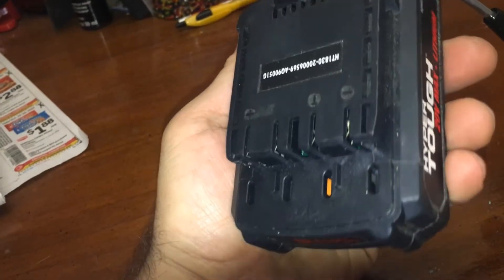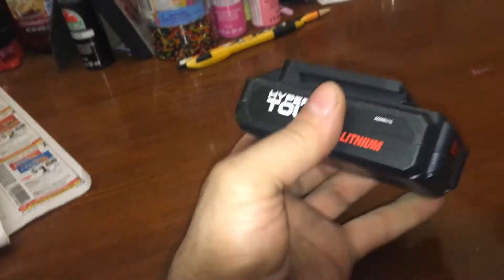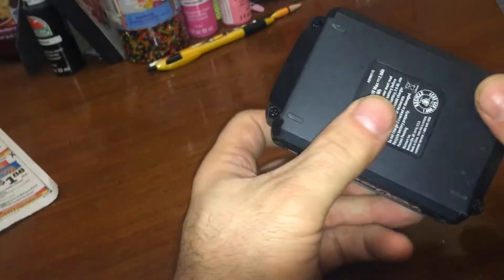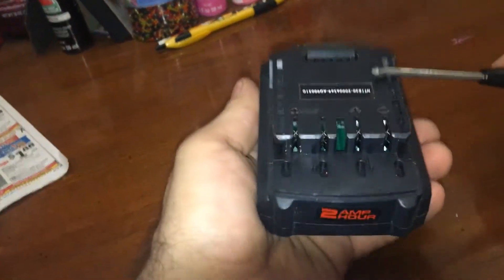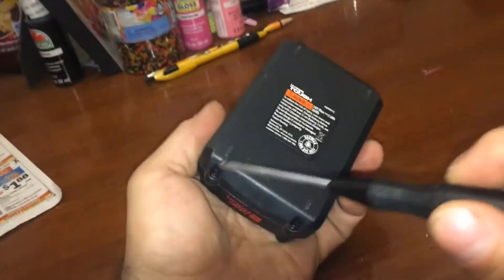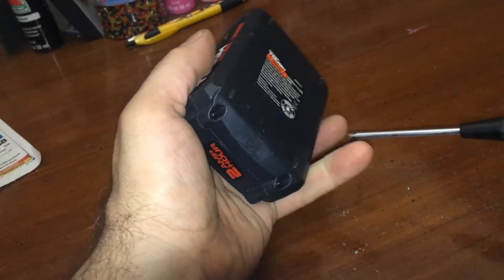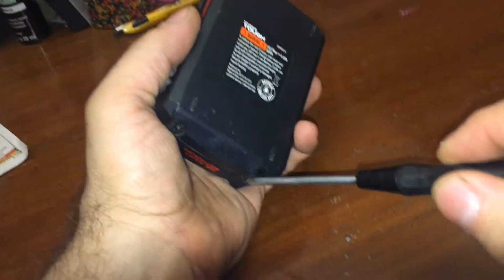I can see the circuit board — that's kind of interesting. I want to see how these are packaged and how easy it is to replace them. These are going to be 2 amp batteries, which is really low for 18650s. I'd like to take those 3350s out of those other things and throw them in here to get a 3.3 amp battery, although we all know those batteries really aren't 3.3 amp.